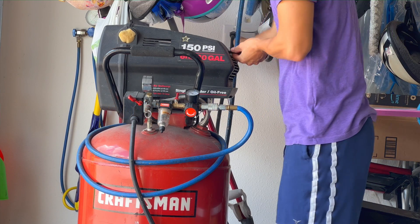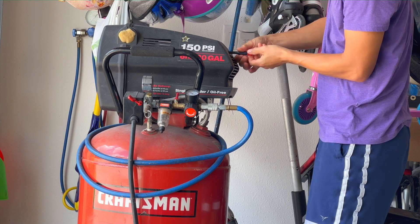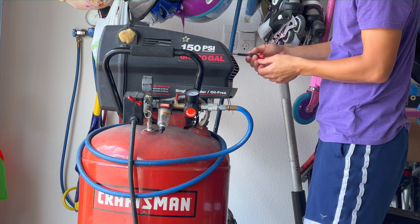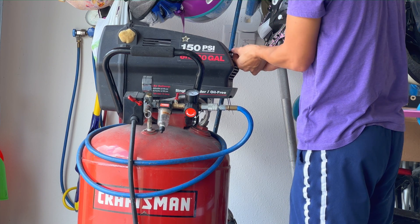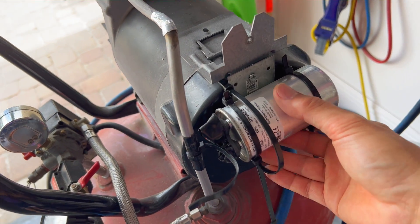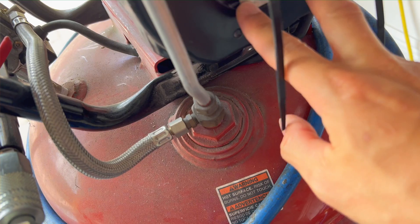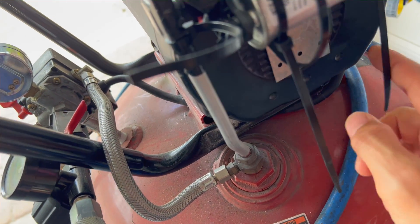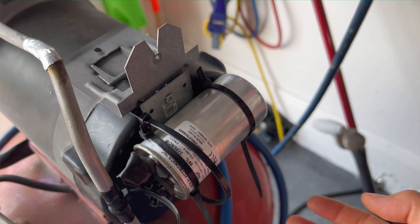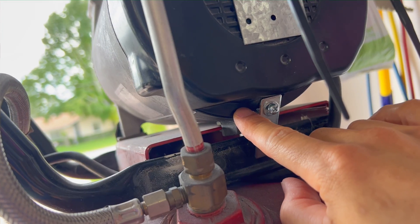If you watched my other video, I actually had to rig this capacitor because the last time I replaced it about 10 years ago, it didn't fit inside the housing. I ended up drilling a hole, running some wires, and mounting it on the outside. You can see I have this 50 microfarad capacitor mounted on the outside, and I rigged this bracket because I've taken the cover off so many times it broke. I used a long screw and a piece of metal to wedge the back cover in — the plastic got too brittle.